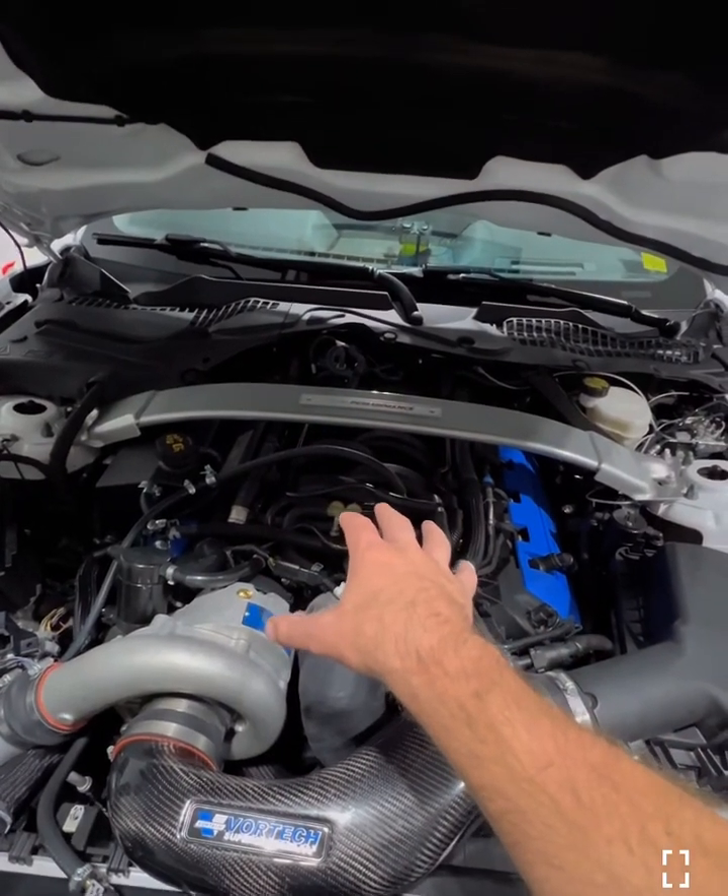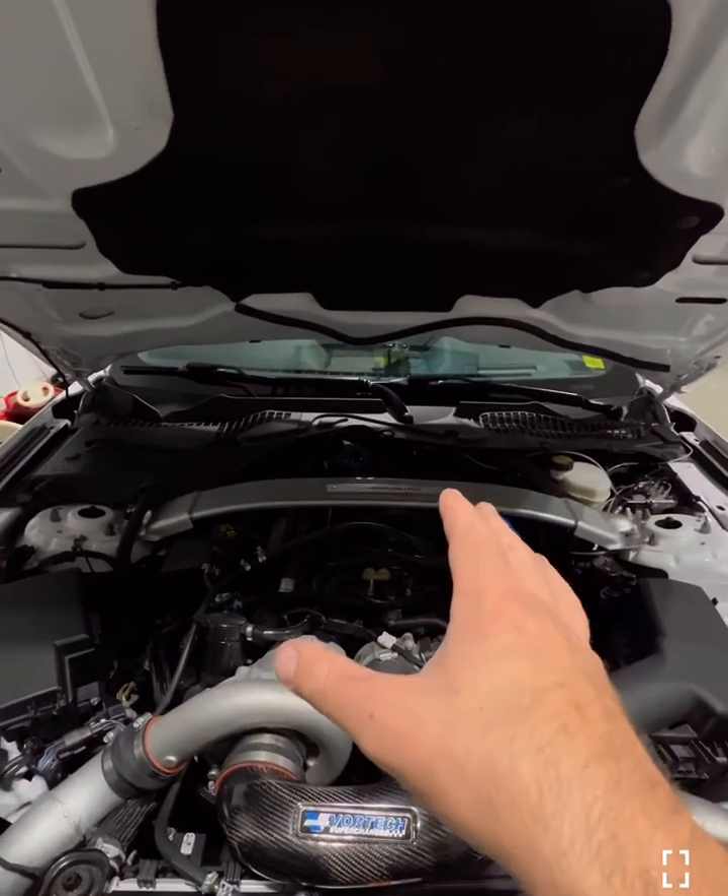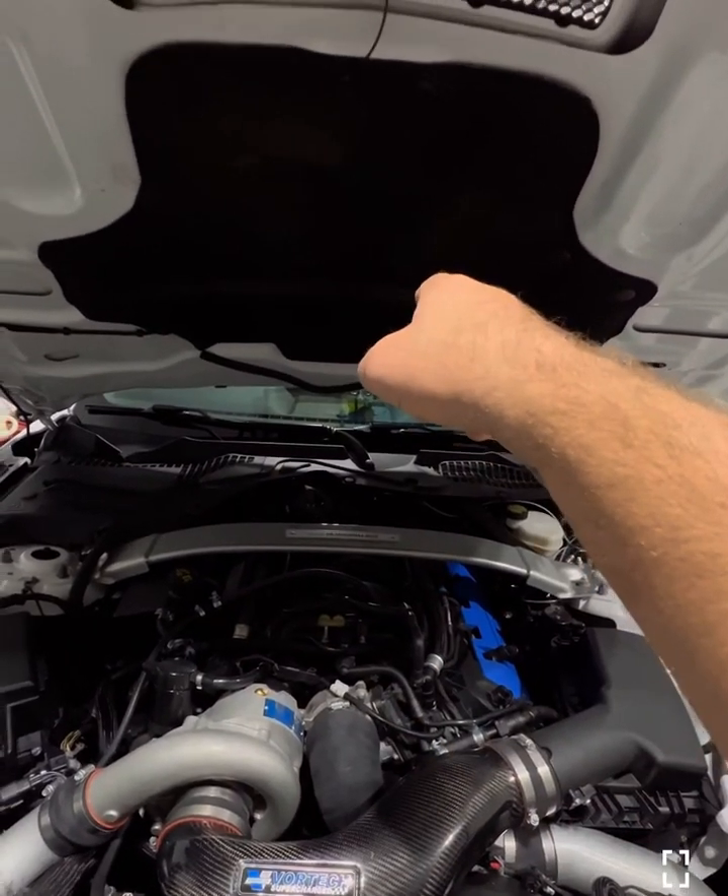What's the benefit of cool air and more air? Well, in an engine you're pulling in air, dripping fuel, and building combustion. That's exploding in the cylinder, driving that crankshaft around, making it turn faster and faster as you get more combustion more quickly. So the more air you get in, the more fuel you can add, therefore exploding each cylinder even quicker. The supercharger is pulling more and more air in much more quickly than just a typical throttle body. Cold air is more dense than warm air, so you can compact more air into each cylinder, making those combustions quicker and turning that crankshaft faster and faster — turning the transmission, the drive shaft, and the rear axle, making those wheels turn faster.